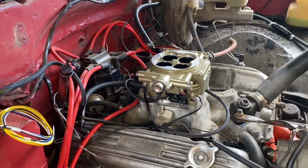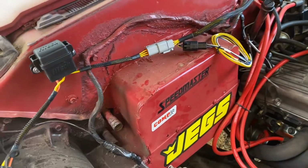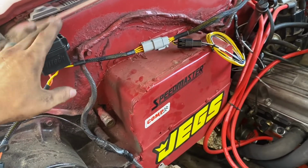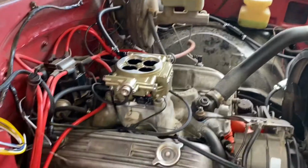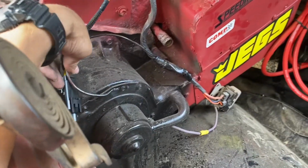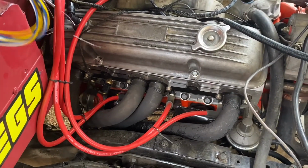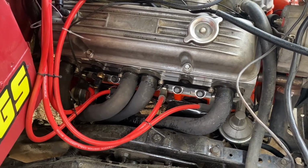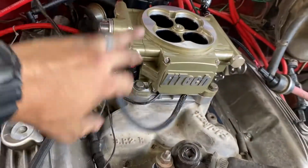Trying to think, I got this mounted. This is kind of a downside, is they said there's no mounting stuff, no drilling or something like that, where they make it sound like you just plug that all in and then you're good, but this does need mounted. This has your main hookup here, and these are all your other stuff, which is like your tach, your ground. I think the yellow does an electric fan, which we don't need to worry about. Good Lord, I think that's it. Just tidy up some wiring and we'll be starting this thing up.